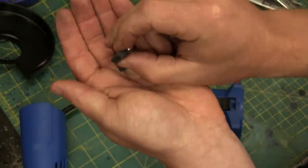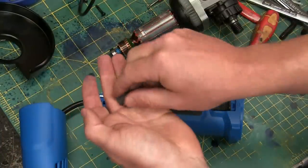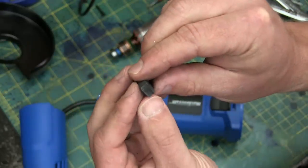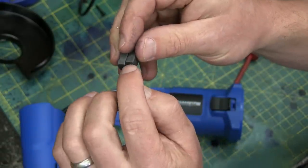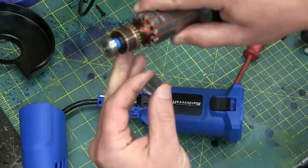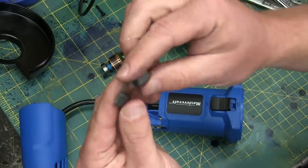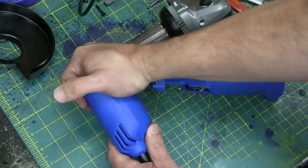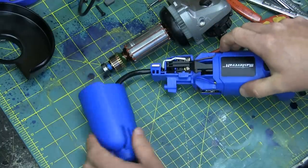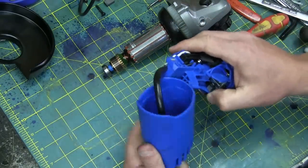Piece of junk — look at the brush. Look at it, it's already chipped. Now you might say that's because I yanked it out, but there's no evidence of that; looks like a factory chip on both sides. That's crappy. But the brush is interesting — it is that toothed pattern for making better contact with the commutator on startup and wind-down. That's great. Other than the breakage, nothing really wrong with these, and the housing is not ABS — that feels like glass fiber reinforced nylon, which is extremely surprising.